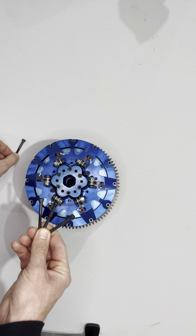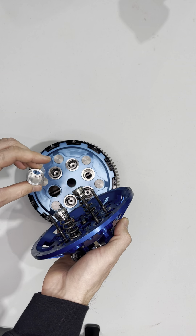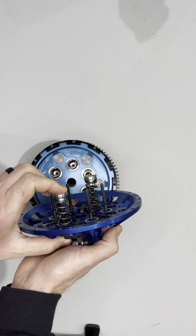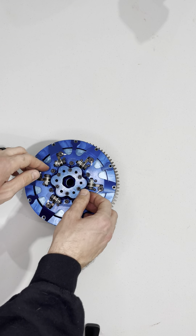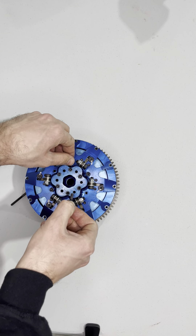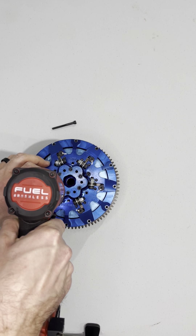Before you change springs and whatnot and check your clutch, what that will do is it keeps the springs — the static springs that go into the cups right here — it holds them together nicely. Now the problem, and what Dustin was trying to describe, is that when you compress these too much, run the screws in too much, then you can actually damage those static springs. So that's just something we wanted to demonstrate real quick and show you what exactly these bolts were for and where they go in the springs.